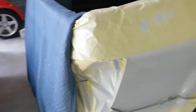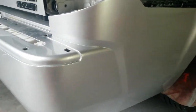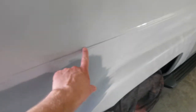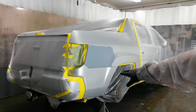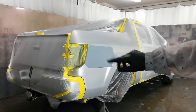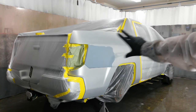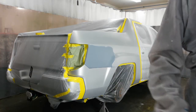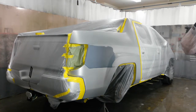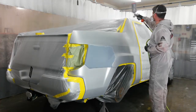Bad news - he told me this bumper had been replaced, but I wasn't sure if it was just a bumper or if it was impacted all the way down the side. We've got body filler at least up to here. I ran the grinder across it, got the paint out of the scratch, tried to V-groove it out real wide. I got a little bit out with the PDR tool through this big hole, but there's something back behind there that won't let me get access. You can see right past the filler there's silver paint - the original primer and silver right behind that filler. Whoever did this just put it straight on top of the paint.